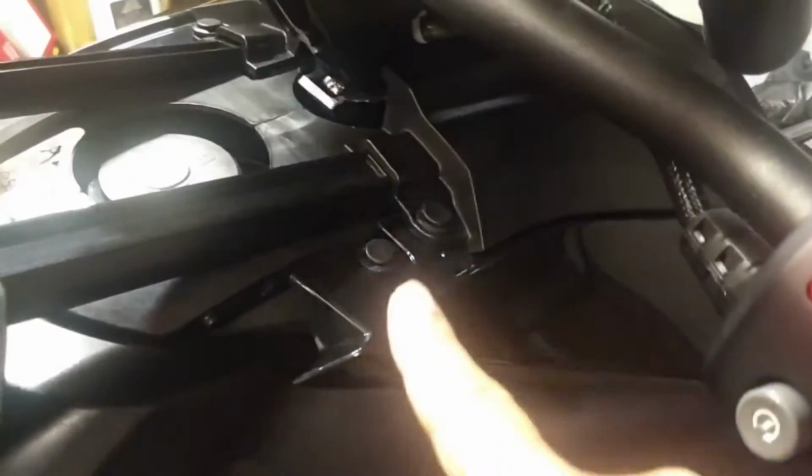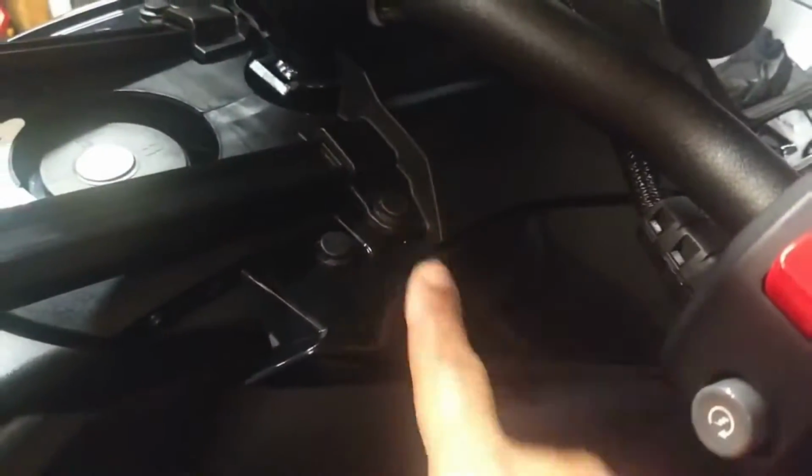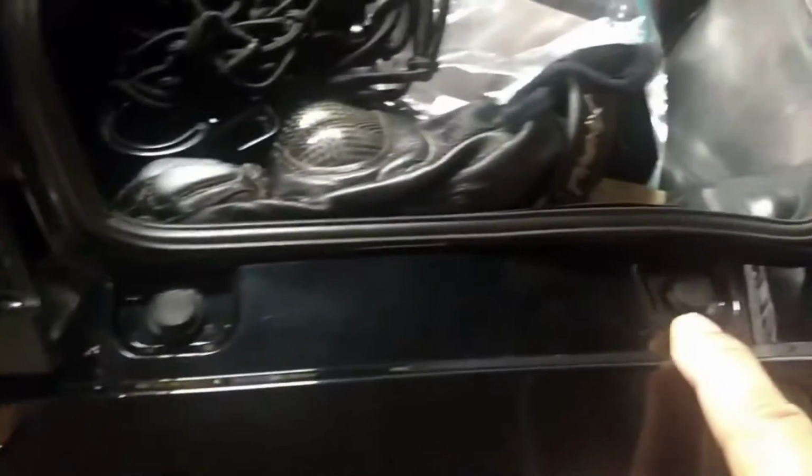This dart pin holds the removable color panels that come on the 2019 and 2020 Can-Am Ryker. First, you want to remove the push pins that hold the color panel in. There are 4 on each side.